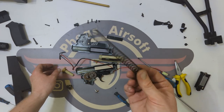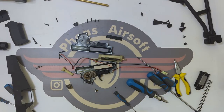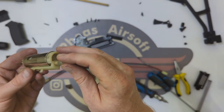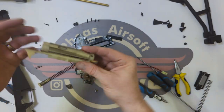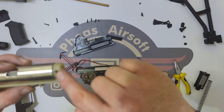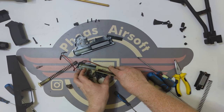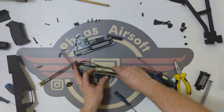So at this point I'm just going to bin the old spring and put in a replacement spring as part of the reassembly — I've got a replacement spring here that I'm going to put in to hopefully make this UK-suitable. I'm going to put the air nozzle on the cylinder head like that, make sure the piston's lined up in line with the tappet plate, and hook the spring on. These lug holes sit on these lugs in the front of the casing. That grease is awful.